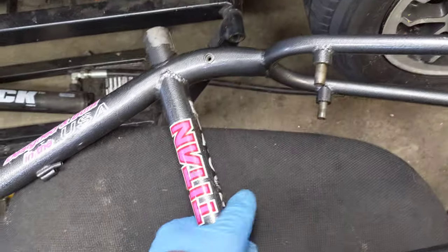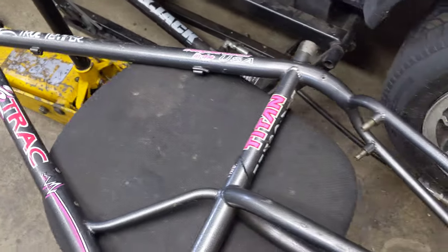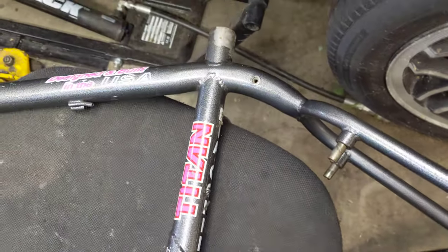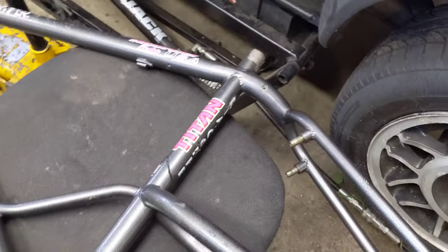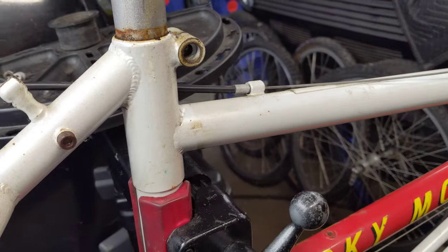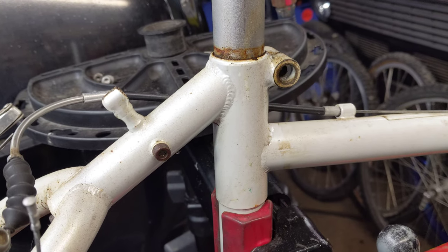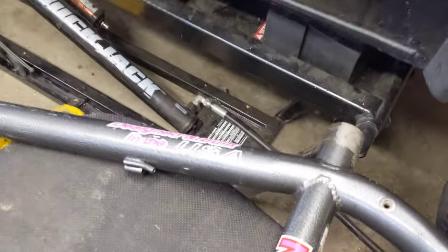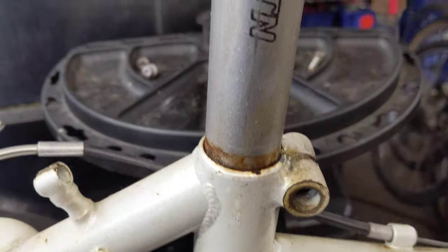This seat tube and whatever aluminum post originally was in here, and whatever alloy they chose to use for True Temper — it could also be the welding here that caused the reaction to be more severe. We have similar welding and brazing going on here, so any change in the metal structure should be pretty similar. The welds aren't quite as nice as the Rocky, but that one's stuck and we'll get it out — it's just gonna take some time. We have to use some mechanical methods.